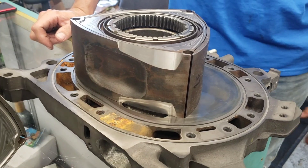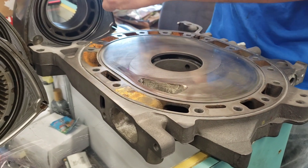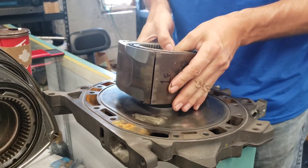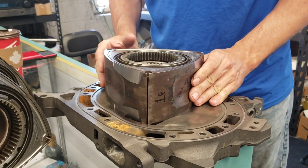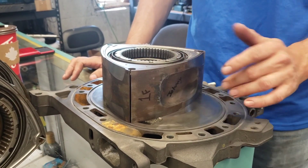Instead of making the port bigger, you're limited on how much material along here, and that web supports the seal — otherwise it wouldn't need to be there. A bridge would open up. A non-scallop bridge port would probably open somewhere around this degree mark here, so that would be a bridge. This would be a scallop — so from bridge to scallop is probably five or ten degrees. This is much more suitable.